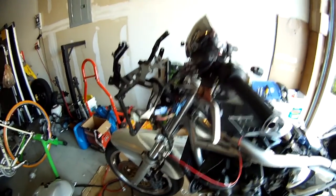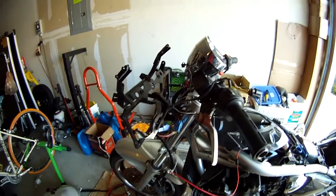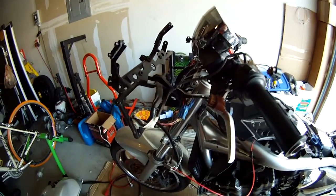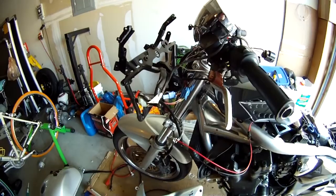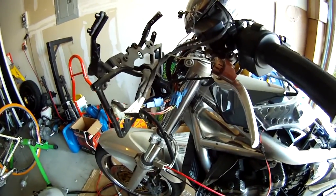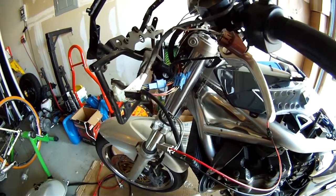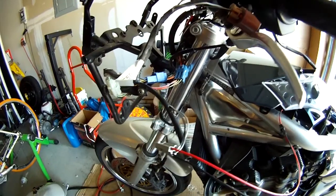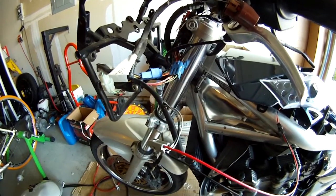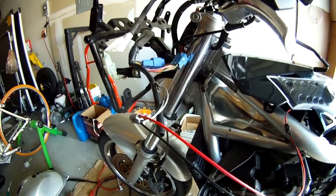So we're running some tests here to see which wires are positive and negative. You can do this with a voltmeter and see which ones produce 12 volts. As I found out, most Japanese bikes seem to go contrary to what the world does, and so the positive is the solid black wire and the negative is the black wire with the white stripe on it.